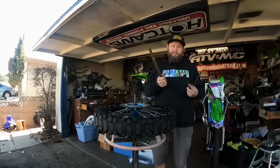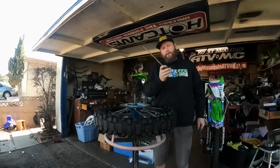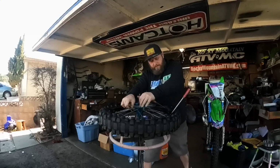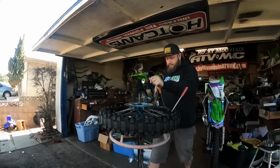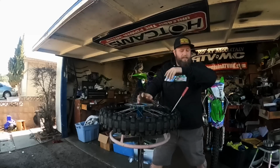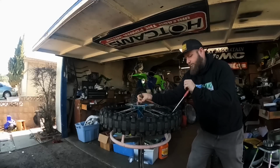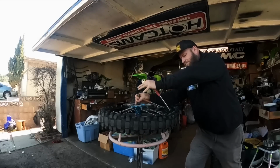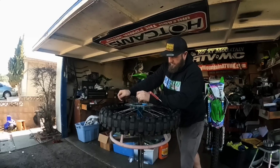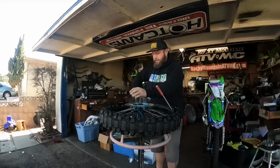This isn't the one that I wanted, but it's the one I'll use. I typically like spoons over irons, personally. That one, so I'll get this one in here now too, because you need 3. There's 1. Tight stretch. This tire is kind of old and brittle, as you can tell. 2, 3. So now with 3 done, you can take the middle one out, go to the next spot.